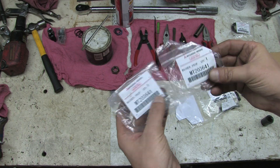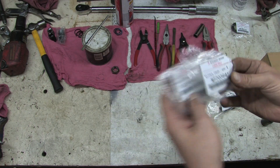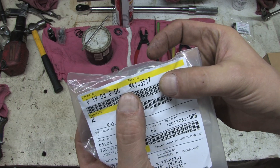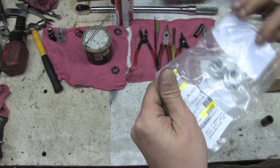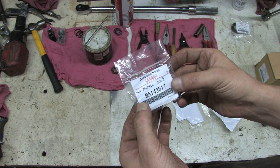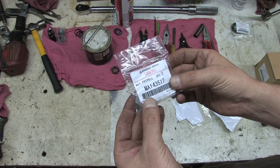There's a tapered edge and a flat edge on the washers — the tapered edge always faces out. The nuts are parts where replacement is mandatory after removing them. They're 27mm single-use lock nuts that won't grab again if you try to reuse them. You absolutely do not want these coming loose while you're driving. Like the washers, there's two of them.